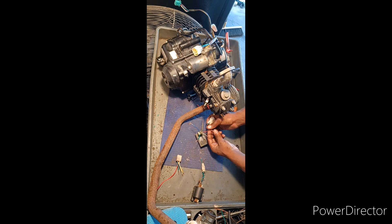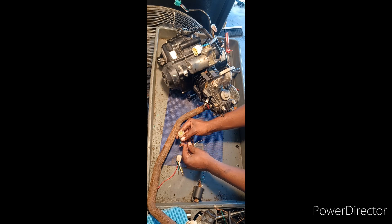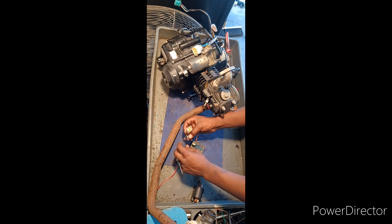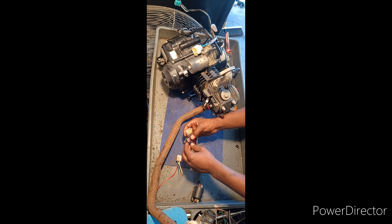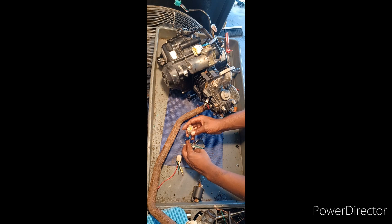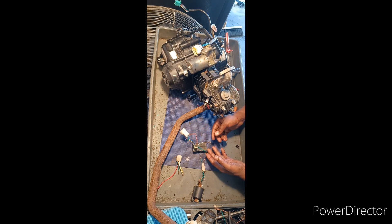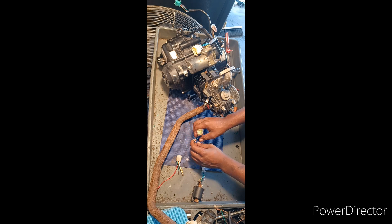...straight into your CDI box. Step number one — hook those together. You could solder these or do whatever you like, but this is me just tinkering in the garage. Your blue signal wire comes around and goes into the blue signal wire on the CDI. We've got the power and the signal hooked up. The green is the ground, and the black and white wire is your kill switch. If you're making a shorty harness and you can't figure out why you don't have spark, you probably grounded out the kill wire — just set that to the side. Then take your ground wire and hook it up.